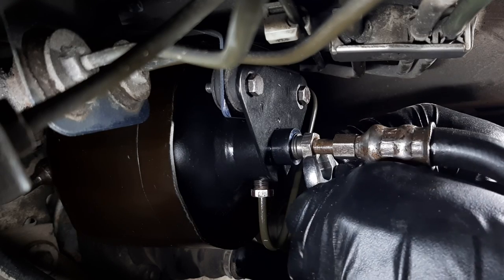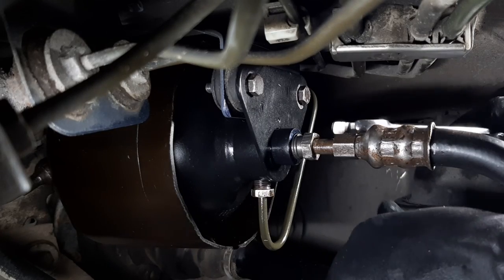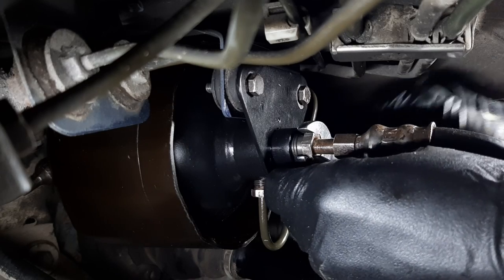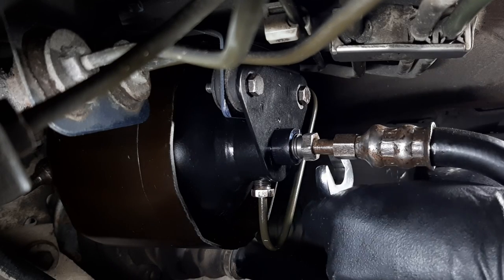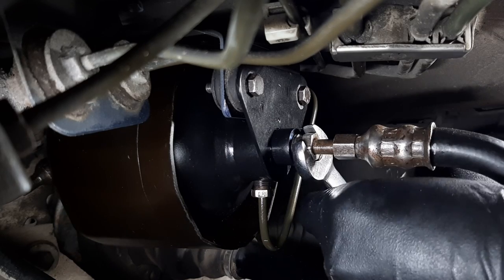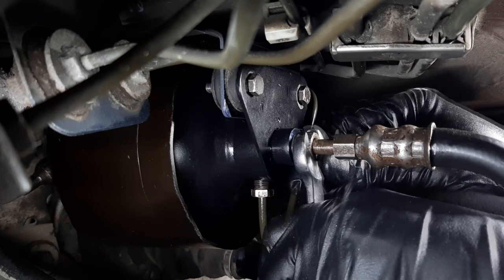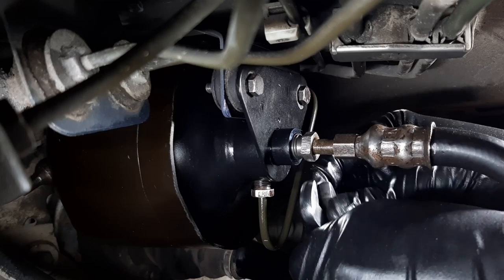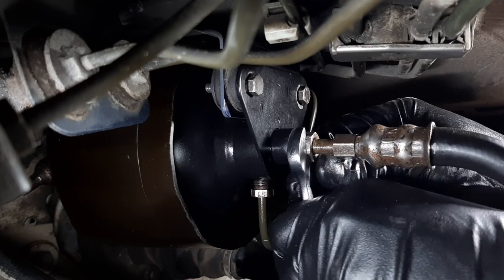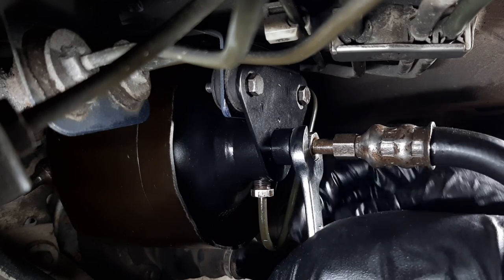So when I'm hitting these sides, my wrench won't go in all the way. So I have to use an alternate angle, like at the top here. Yeah, see, now it works. So this is what happens when you have damaged sides on your fitting. You have to be careful because you don't want to make it worse. So I'm making sure that I have full engagement of the wrench before turning. And I don't want to go like this or like this. You know, I want to be straight in the center. Oh, I think I've hit bottom now.